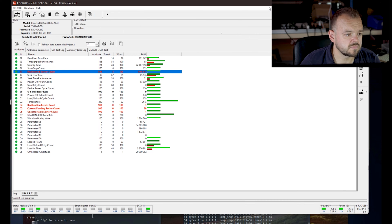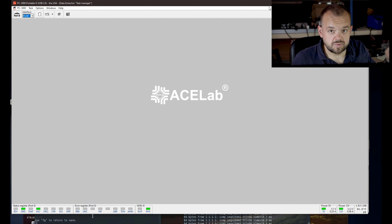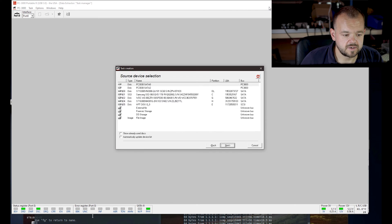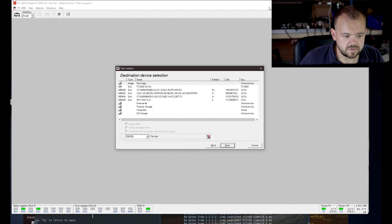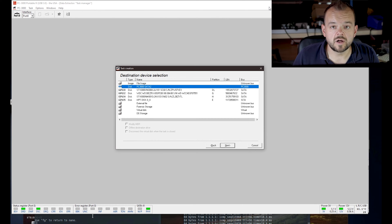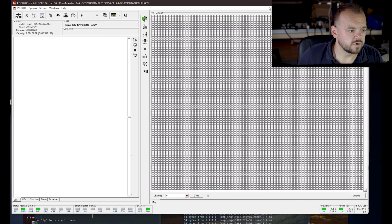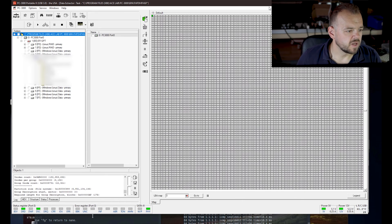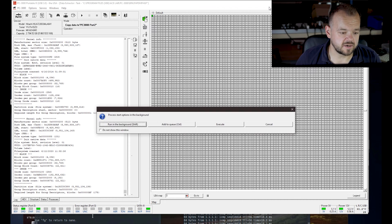We're going to exit this and go into Data Extractor. I have my source and target plugged in, so we're ready for imaging. We're going to start a new case. Source is on this port, going next. The target is on port 2 on PC-3000. Let's see if you can see the file structure here — yeah, we got data here, I can see it. So we're going to exit this and just hit start on imaging and see if it handles any bad areas, then take the clone drive and put it back into MyCloud and it should boot.